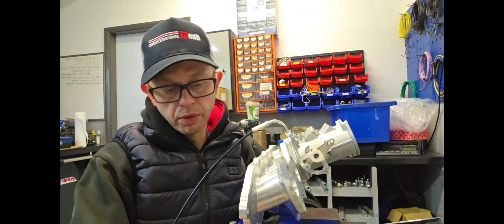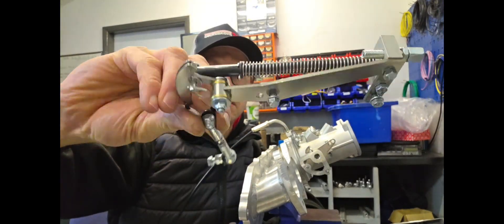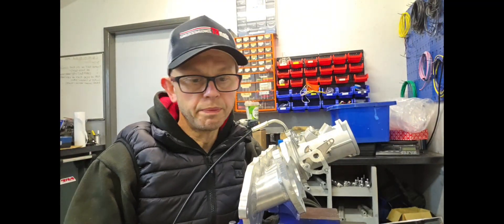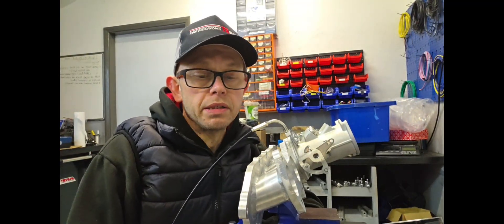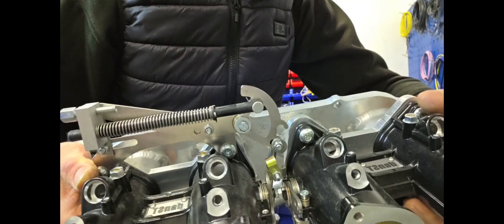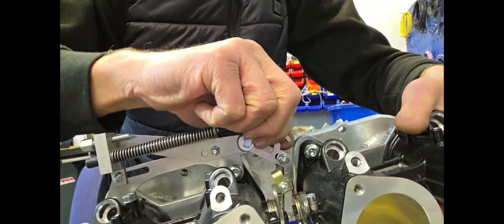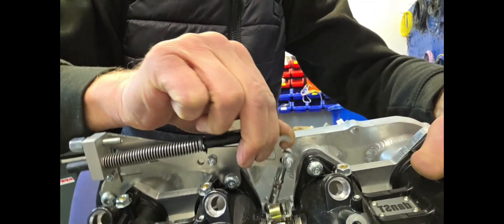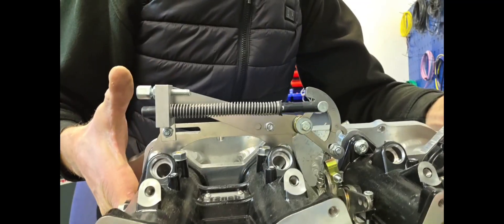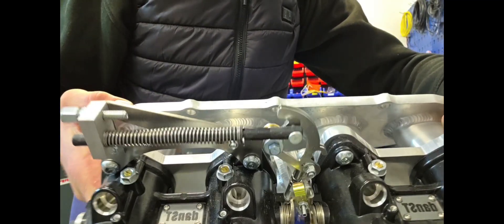You may be familiar with this sort of linkage that we supply — many other manufacturers supply something similar to what came on old Weber carburetors. DCOE throttle bodies like these were meant to be a direct replacement for Webers, so it all follows suit. As you can see on this set here, all mounted up, we've got this ball-jointed linkage system pulled by this cam here. It does work, there's nothing wrong with it, but it can be a bit fiddly to set up and also takes up a lot of room with this large bracket and all the rest of it.